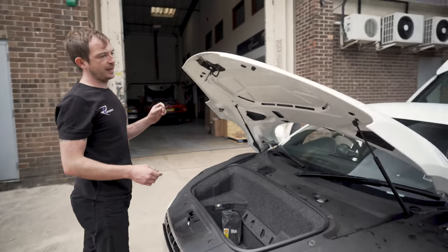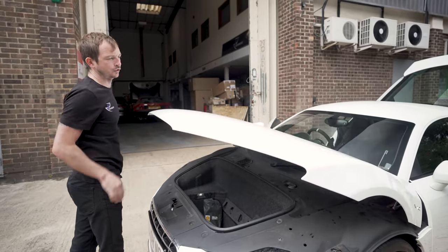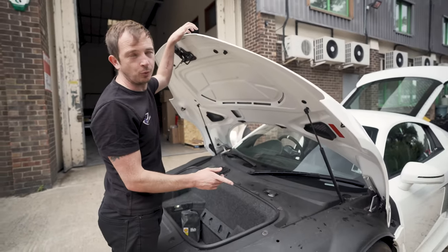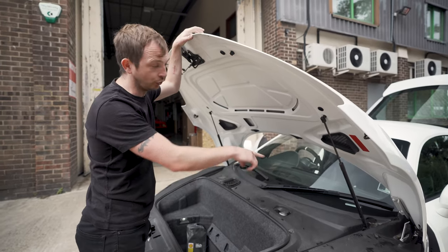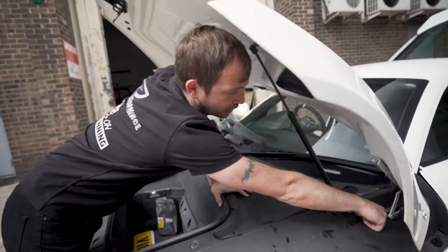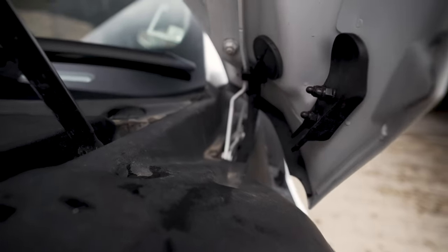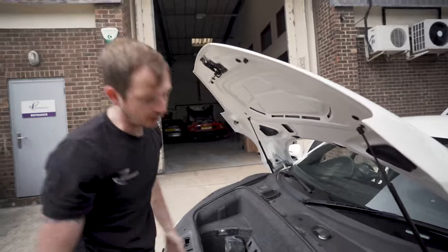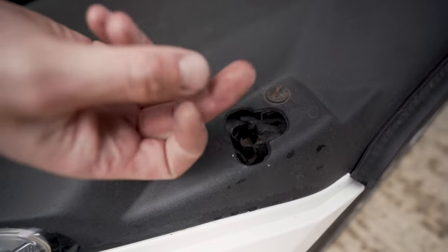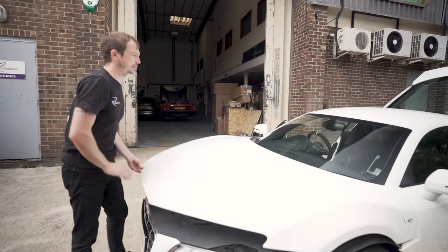They can do bonnet hinges, so it should do that. Just make sure it's pretty free. Don't use white grease. We use WD-40 on all the hinges, doors, boot lids, the lot. All grease does is let the grit and crap stick to the hinges, and they're aluminium pins, so they corrode up. So WD-40, don't use grease. Look at the state of that. It's just grease. So we only ever use WD-40. You don't have to plaster everything with white grease.